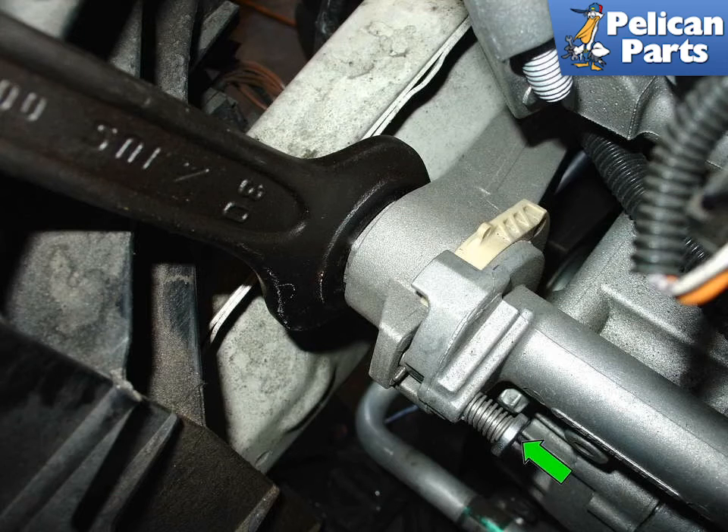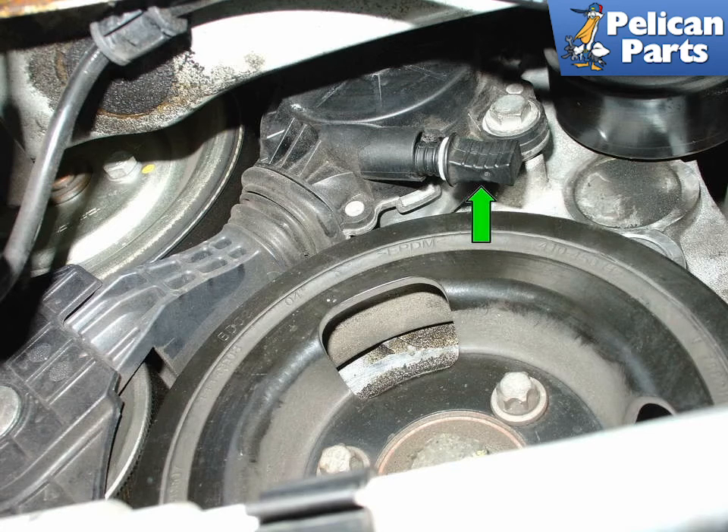From inside the engine compartment, use a 30mm wrench to turn the belt tensioner assembly clockwise. Once fully turned, press the small pin (green arrow) in — this will lock the belt tensioner and slacken the belt. From inside the wheel well, locate the small plastic pull tab on the water pump friction wheel (green arrow). Note: it will be difficult to see as it's tucked up inside. Pull the tab out as far as it will go — this will release the tension on the belt, which rides between the friction wheel and the crankshaft pulley. Now snake the old belt out from inside the engine. Take the new belt and fit it over all of the pulleys. Re-secure the pull tab inside the friction wheel and rotate the belt tensioner clockwise again — as you do, it will release the locking pin. Now just reinstall the wheel, liners, lock bridge, and headlights.